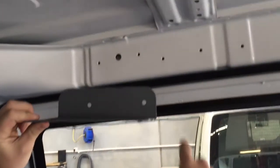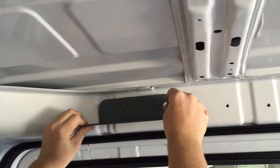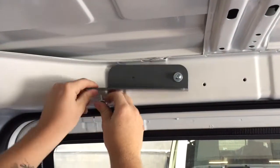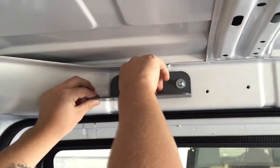Let's get started with the iLoad front mount. Situated behind the driver's seat, place the front iLoad mount over the two front captive points in the vehicle's cant rail, and secure in place with the two supplied flat washers, spring washers and M6 bolt.